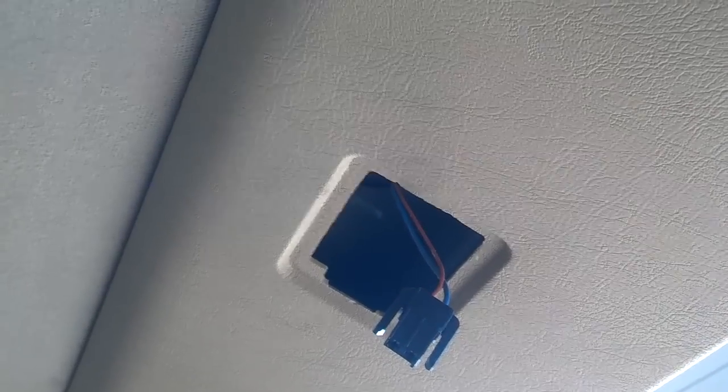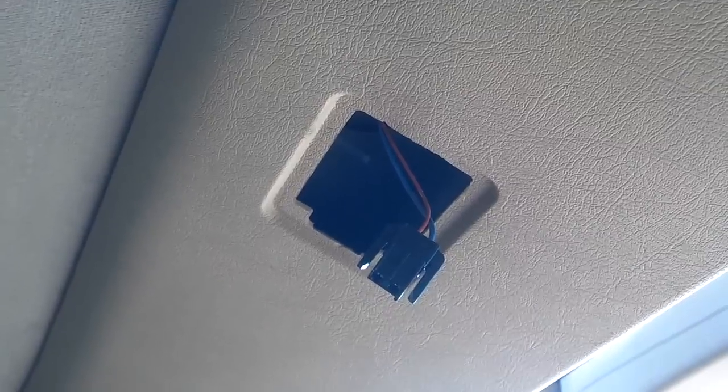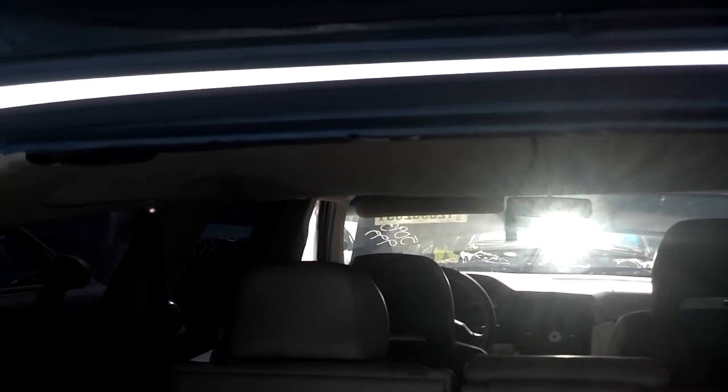Next thing I do is pop this light out from the driver's side, pull it down, and unplug this rear light so that it's out of the trim piece. After those screws are out, work this trim out. It has clips that hold it up there, and this stuff is fragile as glass, so try not to bust it up if that's at all possible. Pull that trim down.